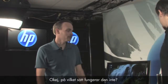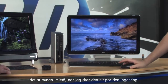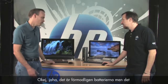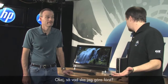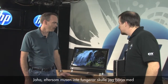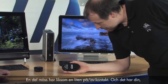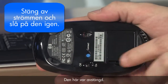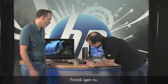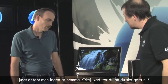Let's start with the very basic: my mouse doesn't work. So how does it not work — the mouse isn't moving on screen. Well, it's probably your batteries, but it could be other things. First, check the underside — some mice have a little on/off switch. Go ahead and toggle it even if it says it's on. See the light come on? That tells you it's working. Go ahead and give it a try. Still nothing, lights on, no one's home.